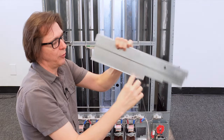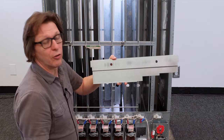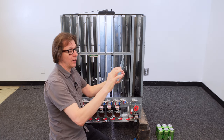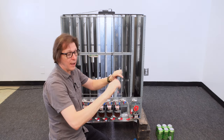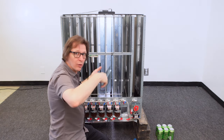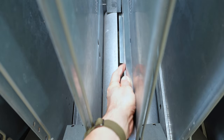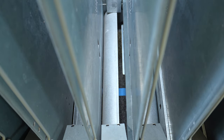Notice the little shelf on the bottle shim is not as wide as the one on a 12-ounce can shim, and it's got these little notches for different sized bottles. That has now been removed. We're now going to take the can shim and place it in there — it goes up against the right-hand side wall, slides down. This is the rear, this is the front, and it's going to slide down and hang on those little metal bars that run the entire width of the chassis. Now the can shim is set in place.